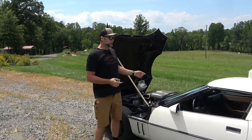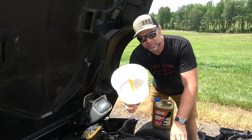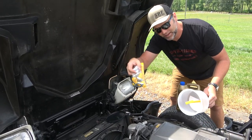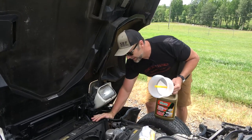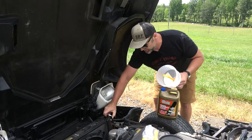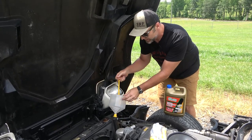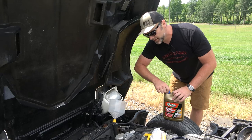We're going to go over here — the coolant filling area is on the other side of the car. So here is the Miracle funnel. This is a funnel that has a seal that fits right into the radiator, and it comes with a bag with all kinds of goodies to fit any kind of radiator in any car. We're going to go ahead and pop the radiator cap. The engine is fairly cool — it's about 110 degrees right now. This thing will fit snugly inside the radiator just like so, giving us a nice seal. Inside this is a plug, so we can remove that plug and go ahead and start pouring in our antifreeze.